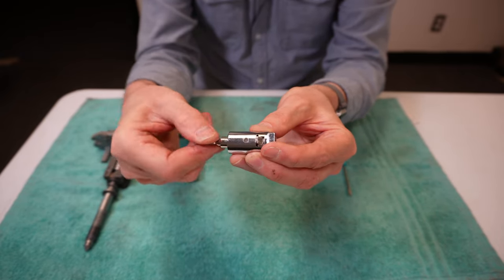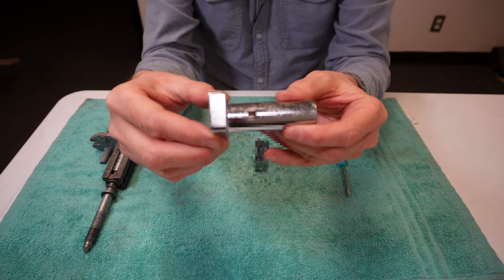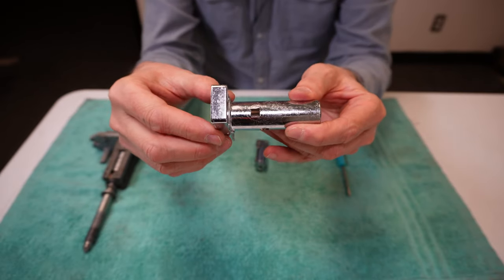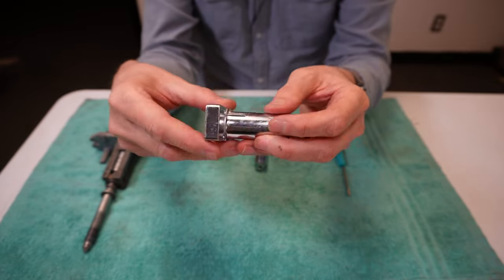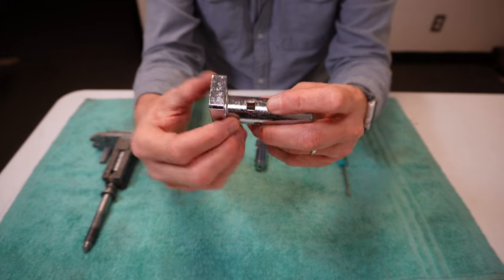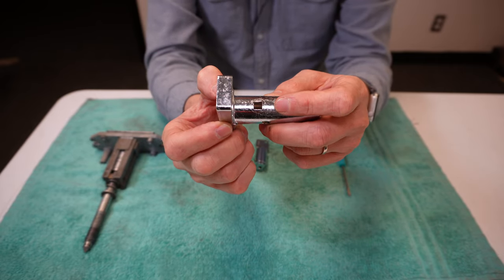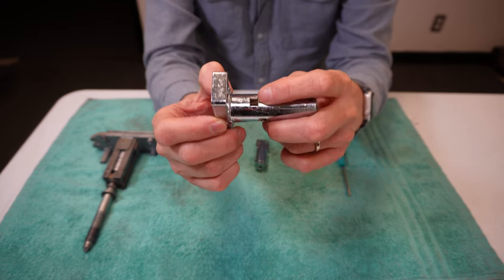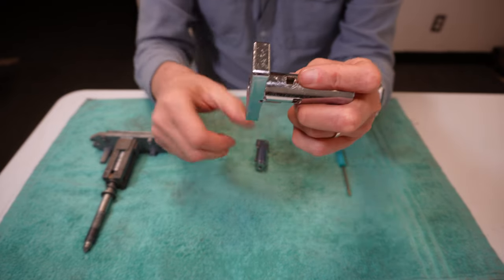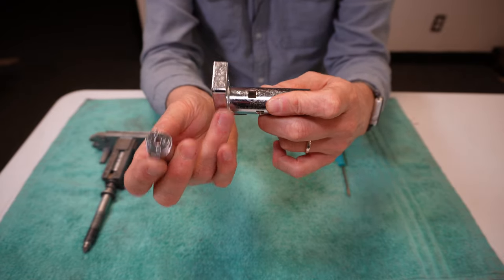This is a typical T-handle out of a drink machine. Depending on the manufacturer's T-handle, you may have one, two, or three little square holes. These little square holes are where the deadbolt will pop through when we insert the plug lock. On most vending machines I've operated, this standard style plug lock will always use the hole closest to the actual T-handle.